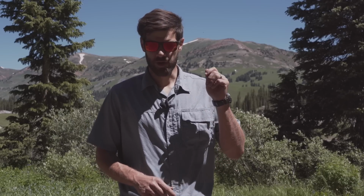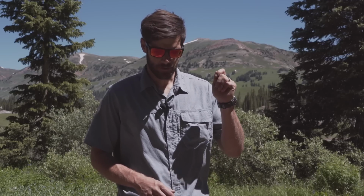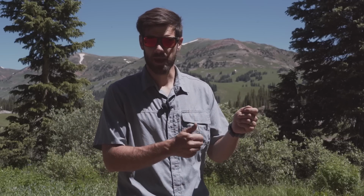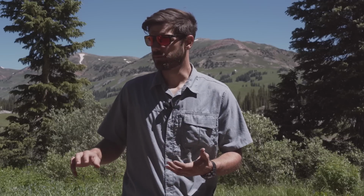So what you have to do is you have to use like a jumper wire. When I did manage to deplete the battery completely, I just ran a wire. I carry a spare section of wire anyway for electrical repairs, and I jumped it from my starter battery to my fuse panel on the positive, and it saw it for just a second. It gave it enough power to where all of a sudden it started charging it again. So it's not that complicated. The chances of you depleting these on a regular basis is probably pretty slim anyway.